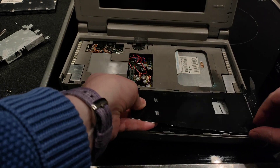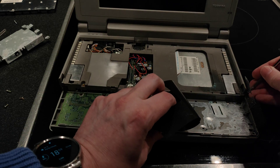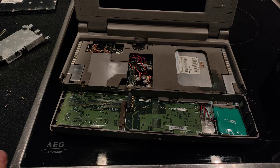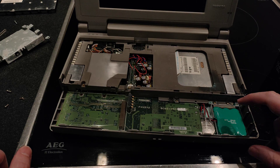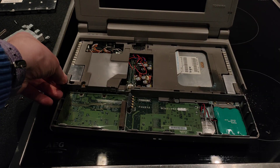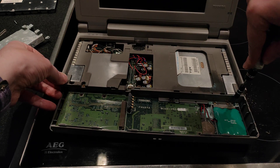It's almost there. I'm going to see if I can get a screwdriver to finish it off. That's certainly not weak yet. This segment's tougher because it's not corroded anymore and it's wider and thicker. The battery's becoming sad — honestly batteries are just a terrible idea all around, cause nothing but trouble. Let me treat the drill to a bit of charge. The metal gets so thin it will just pop out. There goes a chunk of that screw — there we go. Quite acidy down there — so this is the standby battery and this is the CMOS battery. I'll have to look into replacements for both.